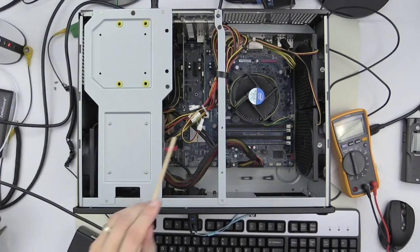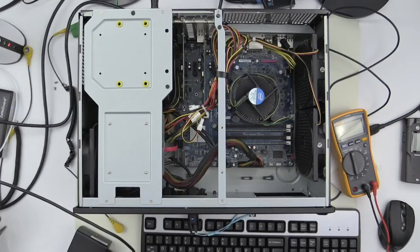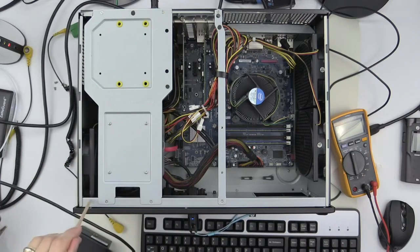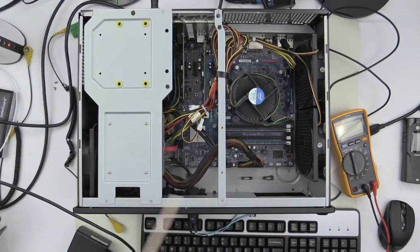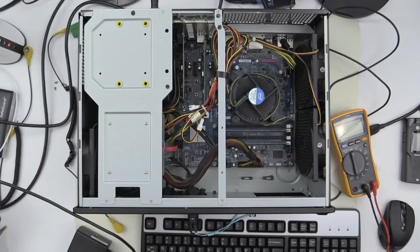That's gone. And I did some cable management here, so everything's nice and tightened up. And moved stuff away back here because there's a fan here also, and so kind of cleared some space for airflow. So all these fans, these 3 and the one on the bottom, are all clean. All the filters are clean. CPU fan is clean. Should run well now.